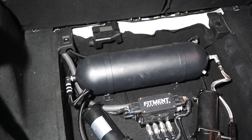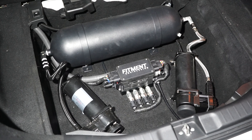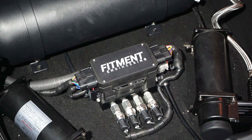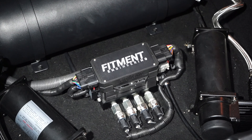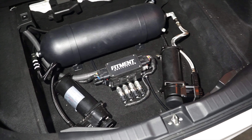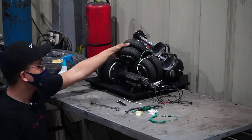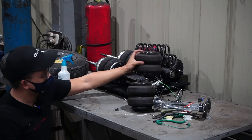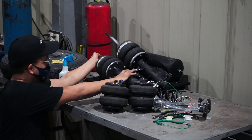Right now we're at the back of the car — this is the system. Let me show you the layout. This is our Fitment Management System — the new system with a new case and industrial sockets, similar to Accuair and Airlift. We're trying to step up our game and move our product at least nationally, with an international dream. It's sporting a pressure sensor package. You may have noticed something — the pumps are different on the left and right. Yes, one actually came from another shop — it was from a previous installation. The previous setup didn't last even a few days, so the client decided to replace everything. The previous shop used stock shocks and their own management system.